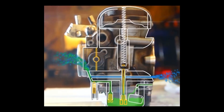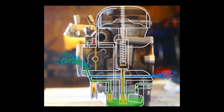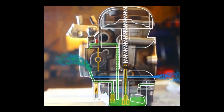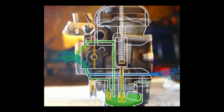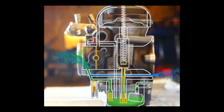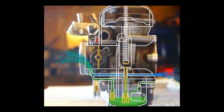Since we are at it, let's see what happens when we pull the choke knob. It opens an additional stream of fuel straight into the cylinder, enriching the mix for an easy start with a cold engine. But let's get back to the idle circuit so we can take a closer look at the mixture screw and how it works.